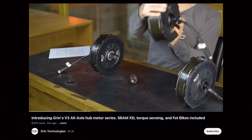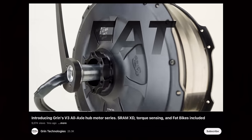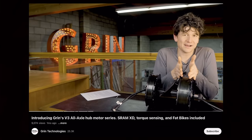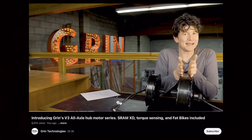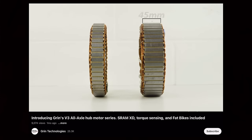The company announced a new version 3, and there is a fat bike variant. A nice side effect of having the motor be wider and bigger is that it produces more power. They said in their launch video it has 50% more torque, simply because the magnets and the stator are close to double the width.